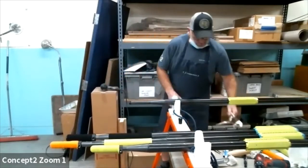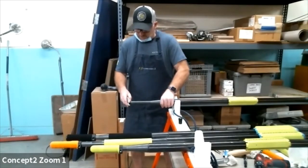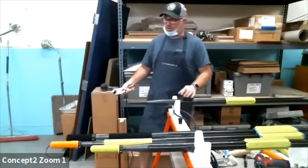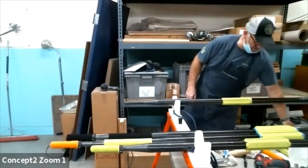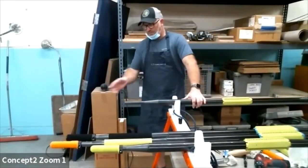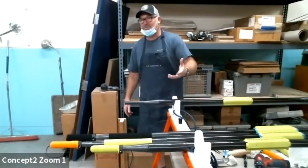Just a couple minutes it takes to get it hot. I can see this one's almost ready. I've got vice grips here — what you want to do is clamp right onto the M-plug with vice grips and turn it. You see it turns right out. You'll notice it's got some smoking to it — it's not advisable to breathe that because that is Loctite that you've heated up. Let it ventilate. If you want to wear a mask, you can.